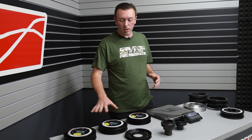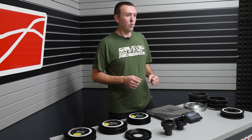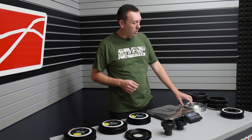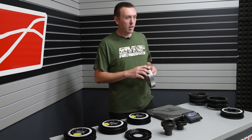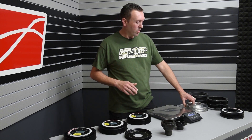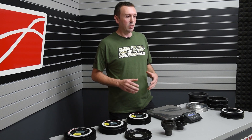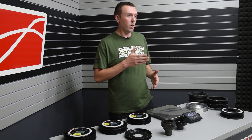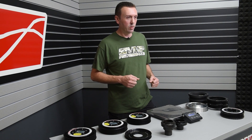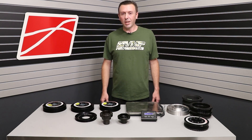The new style balancer uses a different pulley alignment or offset that is standard with the new Shelby GT500. VMP's old 5%, 15%, 25% 10-rib kits are not compatible with any of the new parts. However, we highly recommend you convert to the new system because it is better for crankshaft durability in terms of weight and where that weight is placed on the crank. These balancers are available now on the VMP website. Keep watching for more information on the upcoming 8 and 10-rib kits for Gen 3R and Odin.